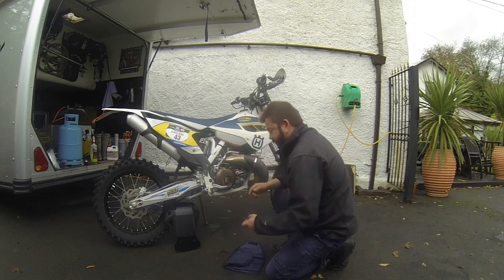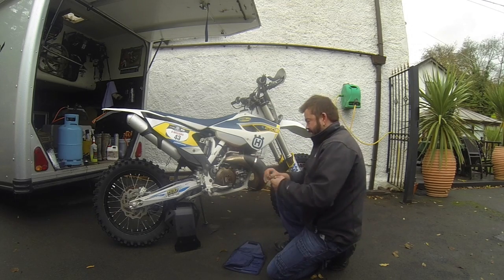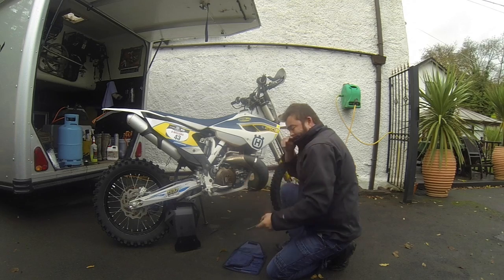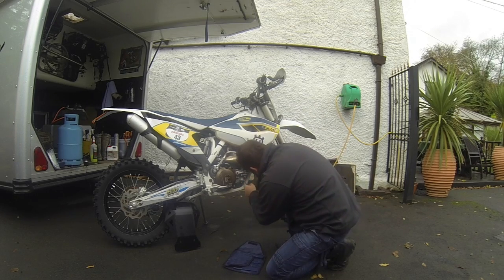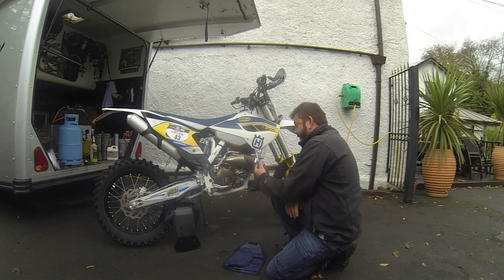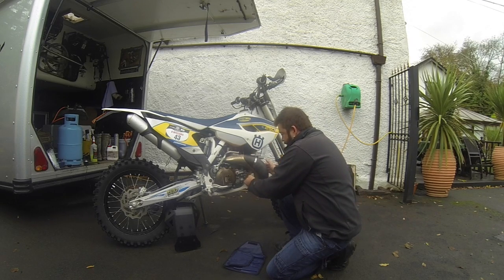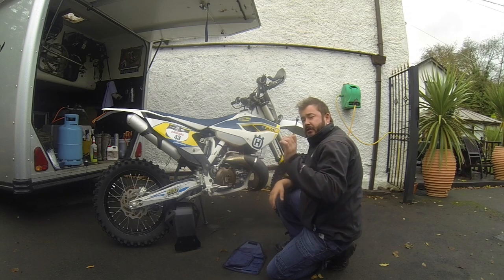Now, this PH2 is the perfect size for the power valve. So just push it in tight and you can wind it, no bother at all. So all these people who are going online and trying to find this, which is not a quarter drive, the PH2 is a perfect fit to adjust your power valve on the move.